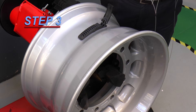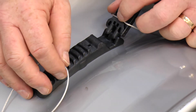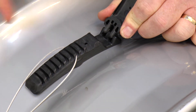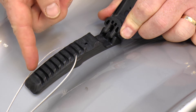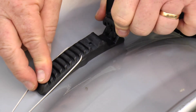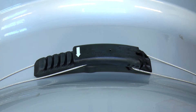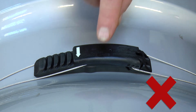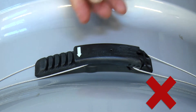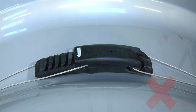Step three: wrap the cable around the rim, making sure the cable is correctly seated on the lever side, engaging the loop in one of the multiple notches in order to set the tension. Clipping should be achieved by using moderate strength of one hand. If you can move the sensor in any way or lift the lever, tighten the cable one more notch.